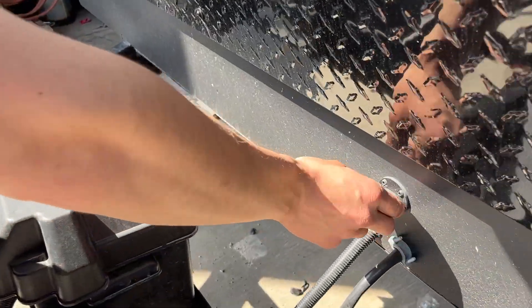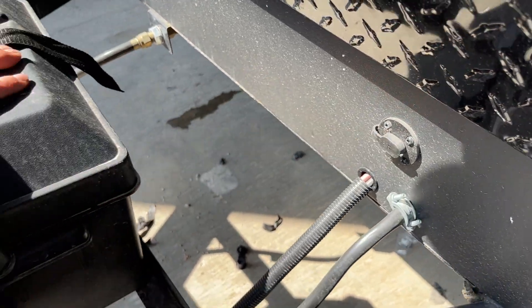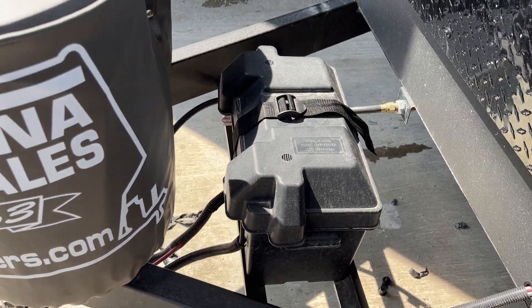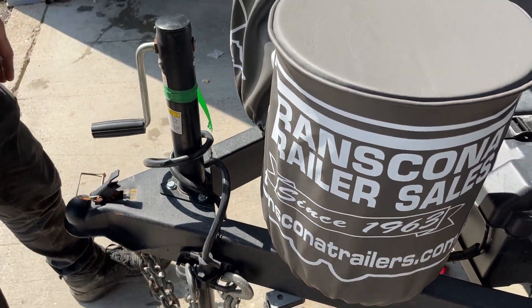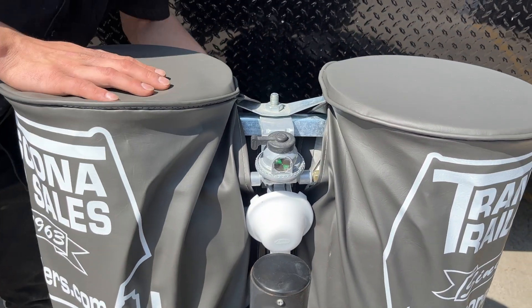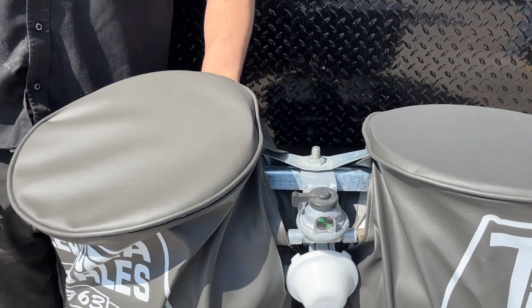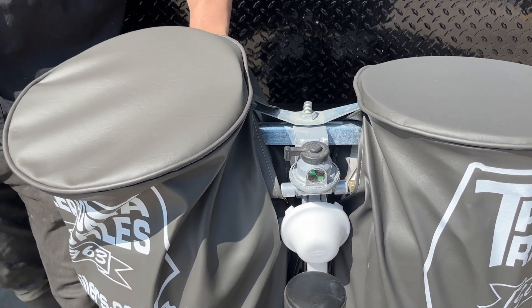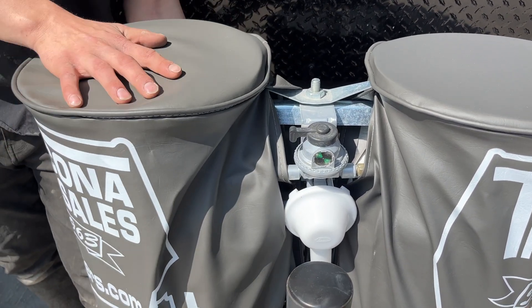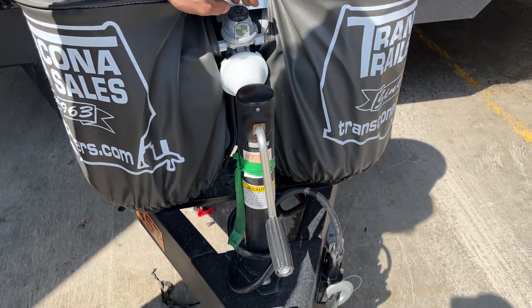Coming to the front of the unit, you have a solar panel inlet — just a little two-prong plug that charges your batteries. The battery itself is inside this box here, and as long as you're plugged in through your shore cord to your tow vehicle, the battery's charging. Underneath these covers are the propane tanks. You can see the arrows pointing to which tank you're running off, so just reach in, get that valve, and turn it open. If the indicator goes red while the tank is open, it's letting you know it's empty — just close it off, switch the changeover, and run off the other tank.